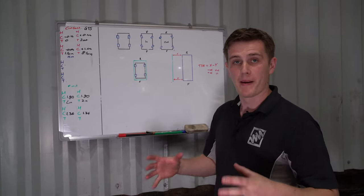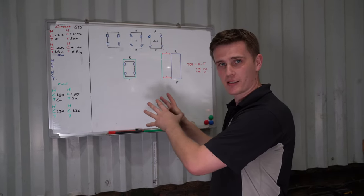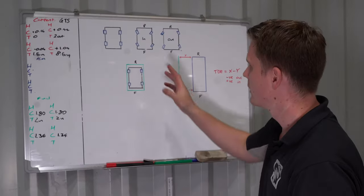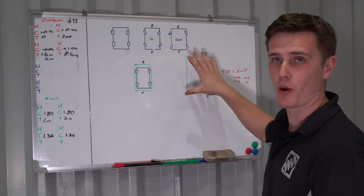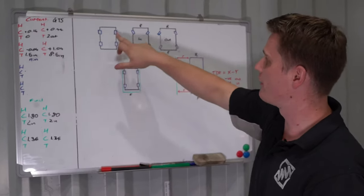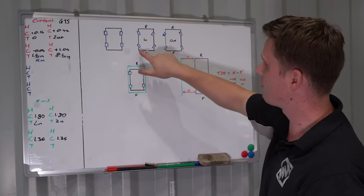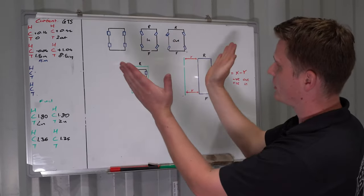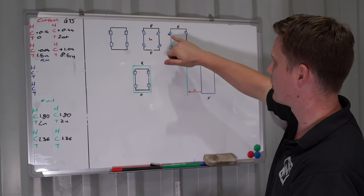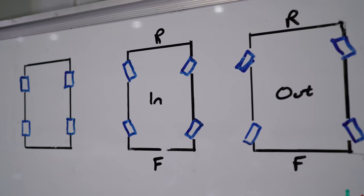The string and line kit is used for measuring toe on a vehicle. Before we get into building the kit we'll briefly cover what toe is, what toe in and toe out is, and how we're going to measure it with the kit. We've drawn a simple diagram on the whiteboard. Here we've got a basic square resembling a car with four wheels at each corner, front and rear. If the front edge of the wheel is pointing inwards that's known as toe in, and if it's pointing outwards that's toe out, represented here on the front and rear axles.